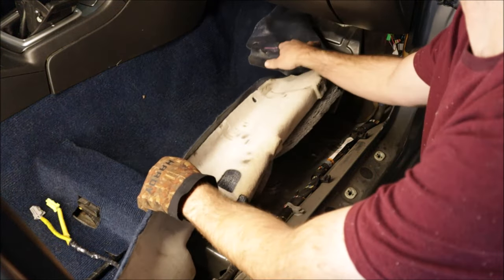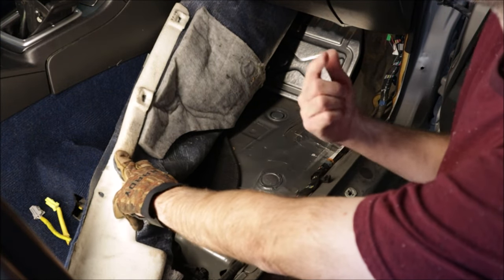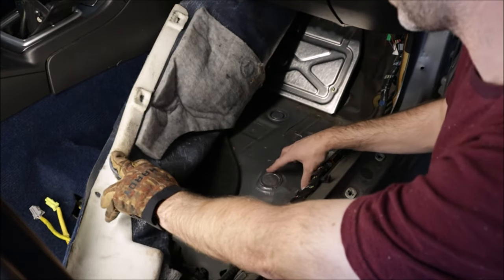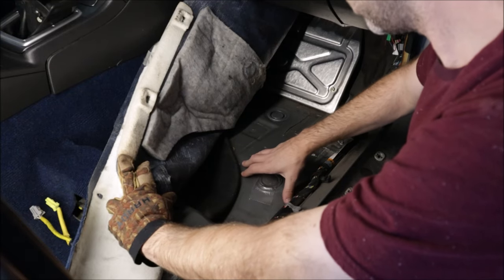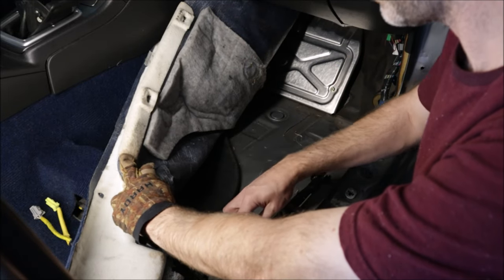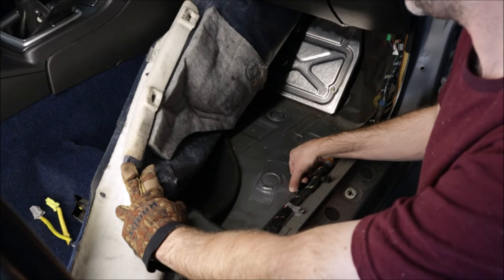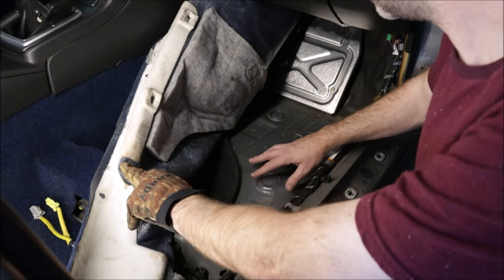Pulling the carpet back, you can see all this whole area that got pushed up. Under the car there's actually a perfect little circular mark where there was a hoist or jack or something that pushed right up on here, actually on both sides — the other side isn't as bad. You can see how this stud is completely pointed this way; it should be straight up like this one here. I don't want to break a bunch of the seam sealer or any of the spot welds out. The seat sits in here fine, so none of this bracketry has been messed up. I'm just going to use my hammer skills and try to get this a little bit more flat.